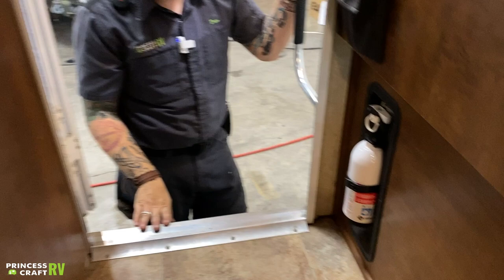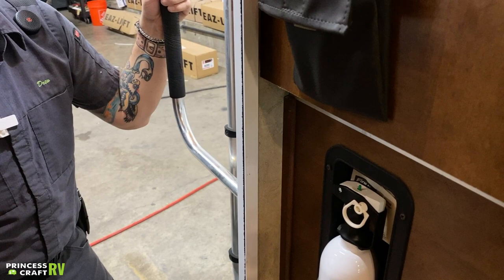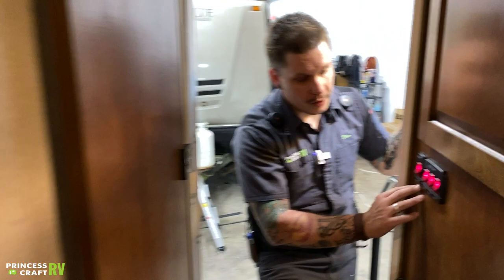Here in the doorway we see your fire extinguisher — part of your safety equipment. It's very important that we test all safety equipment every single time we take the unit out. For the fire extinguisher, push the green test tab down; if it springs back, we still have life in the unit. If not, it is time to pull it out and replace it. We want all safety equipment to be operational in the event that we need it.